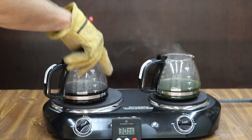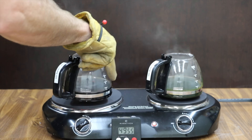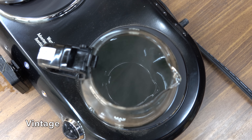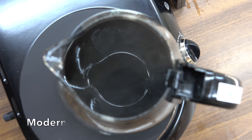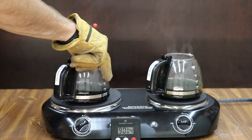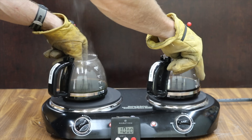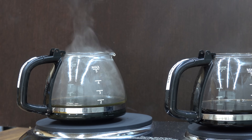Why this test? The NOAC volatility test exposes oil to even more heat than this to simulate engine operating conditions around the upper piston ring area. High quality oils resist evaporation and thermal breakdown. At the end of this test, we'll see how much evaporation has occurred with each brand. Look at all the vapor coming off of that vintage oil — that's a lot of vapor.